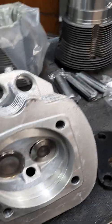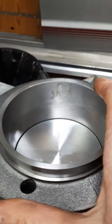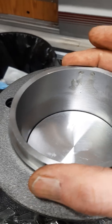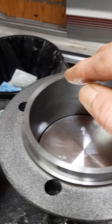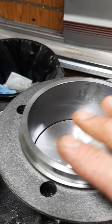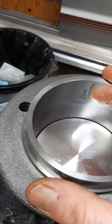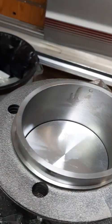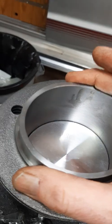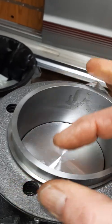I want to keep it around 8.5 to 1 — even 8 to 1 would be fine. Good set of pistons here; I really like these. They've got a really nice wide flange. I'm used to building the larger engines that have a larger bore, and then you lose some of the deck or cylinder dimension, which runs more of a risk of having compression leaks since you don't run head gaskets. With the 85.5s and the really thick wall, unless you buy an oversized cylinder like a 1680 with oversized cylinders, you still have to bore the block to I think 90 or 90.2 in the heads to accept those barrels, but you're only stepping up to a 1680 with thick walls.